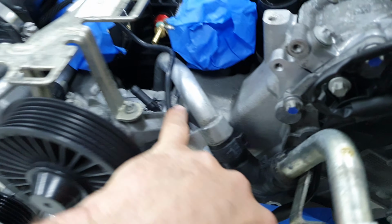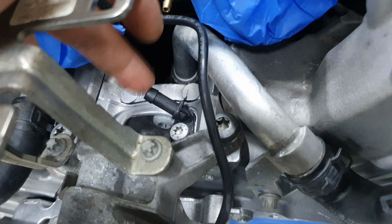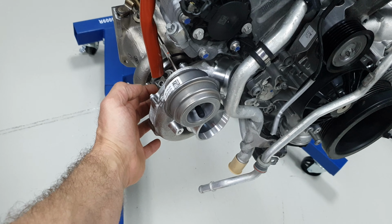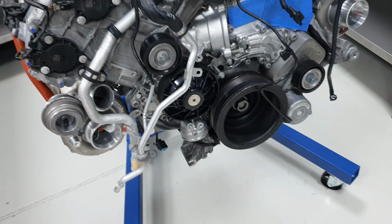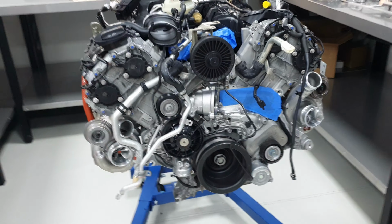Now that I remember, also this bolt, and this bolt, I have changed. I have replaced it because the previous one I had here was very short. It was not the right one. And I put also the new fitting for the breather here. The pipes are supposed to be outside with the guys. The same thing also for the coolant lines for the turbocharger, and the oil return. Need also the gaskets down. Classic stuff. That's it. Over and out. Thank you.